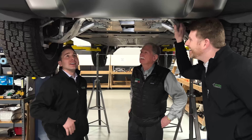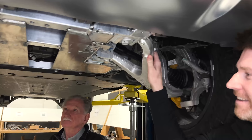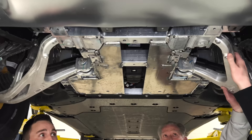Just at first glance, looking under the vehicle, it's actually very reminiscent of the old Model S when it came out. If you look underneath, the whole subframe or cradle is almost exclusively aluminum extrusion. That's great in terms of quick adaptations as you're developing a program — the tooling is dirt cheap, and you get to save some weight and still get the structure you need.